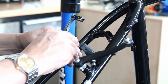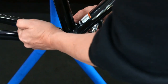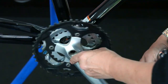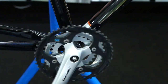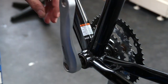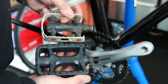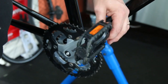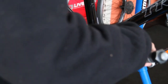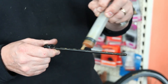I always replace the brake pads because it's a selling feature - new brake pads fitted. You can see the chainset bolts here: new ones against the old ones. New bolts cost a couple of pounds and you've got a bike that looks so much nicer. As soon as a customer comes in to look at a used bike, they'll be looking for rust. Rusty screws on the old pedals are a red flag. These replacement pedals are used but they present better - nice and clean, no rust. A little bit of grease on everything doesn't go amiss.